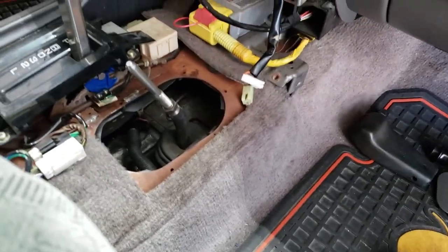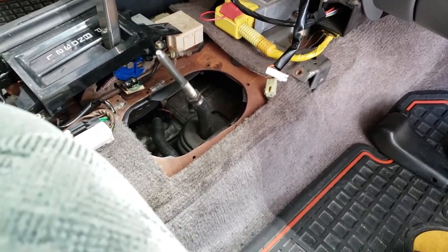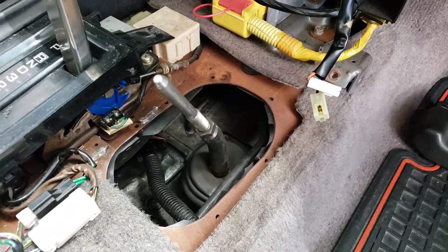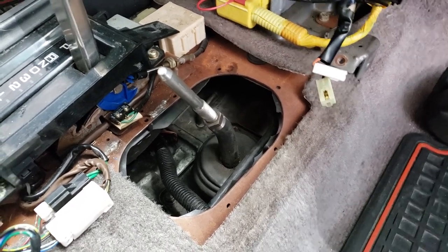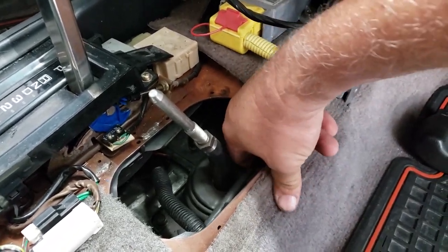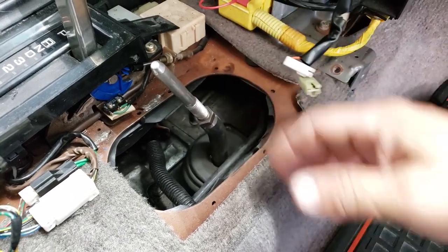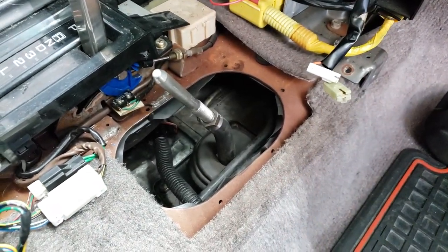I'm working on Fiona, and I figured I might as well make a video on how I'm gonna fix it. I posted on the Planet and on the Trader that this fucker in Fiona was rattling around 1500 RPM. Turns out the douchebag before me left the two fuel lines just sitting here, and they were over here touching the shift lever. So when I grabbed the shift lever and pulled it hard up or down, the noise would go away.